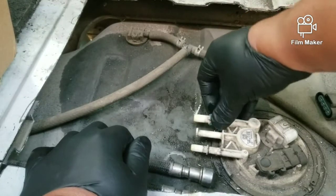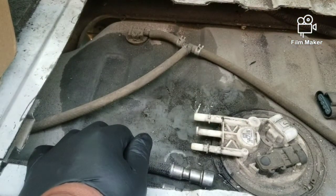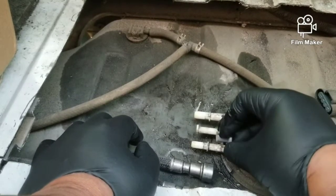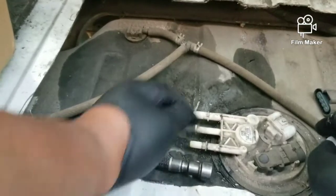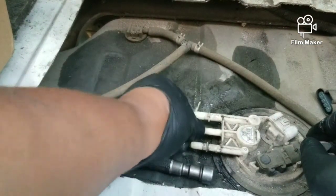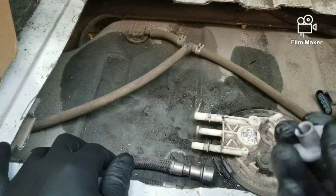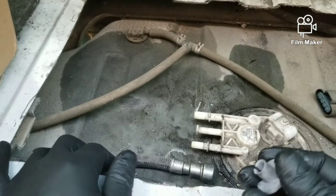These blue plastic ones tend to work out a lot better. That's for 3/8. This gray one right here works the same way. This is a 5/16. You just snap it on, put it up on there, push it towards the pump, and then pull out, and it'll come right out. This line in the center is just a vent, so you don't have to worry about that. You can pick these up at your local parts store, AutoZone, Advance, O'Reilly, NAPA, wherever you shop.